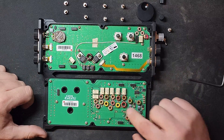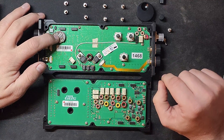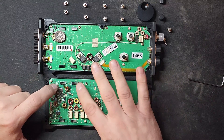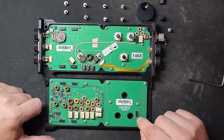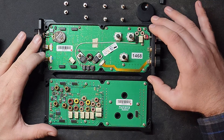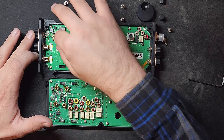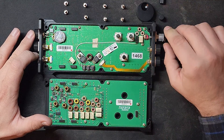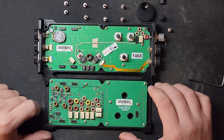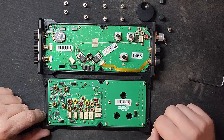Very nicely wound toroids inside. We're going to check that battery — it looks like it's seated in there. You have to be very careful with these pins; you don't want them bent or damaged in any way, as they will cause major issues in the future. You can see how nicely it sits — there are a bunch of ribbon cables you have to be careful of, but a very nice, beautiful design. That coin battery, which is the memory retention battery that holds settings in memory, is seated properly. Beautiful toroids. Surprised there's no gasket, but I guess it's not needed.